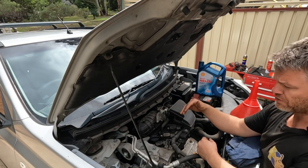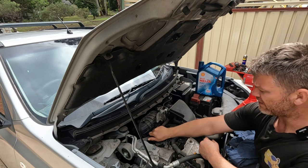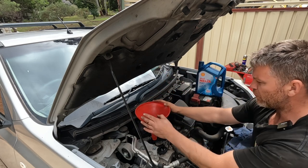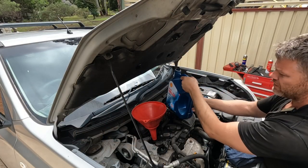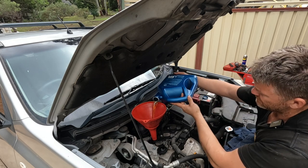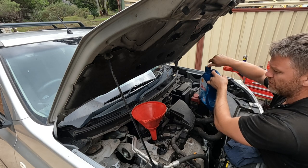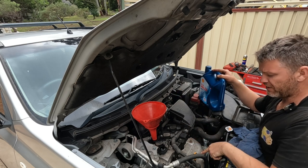Because we're on the ramps, I'll put four litres in for now until I get it back on level ground. According to the internet, 4.6 litres goes into these cars. Take the oil cap off — you'll need a funnel, though some oil containers come with funnels. Mark your container or have an idea of where five litres and one litre are, and tip it in, measuring as you go. I wouldn't go the full 4.6 straight up — go about four or four and a bit, then double check the dipstick.